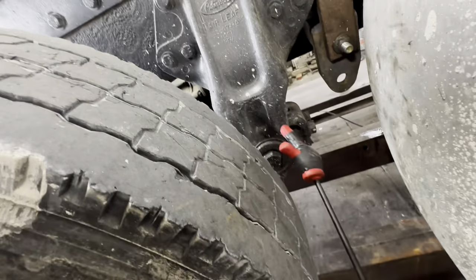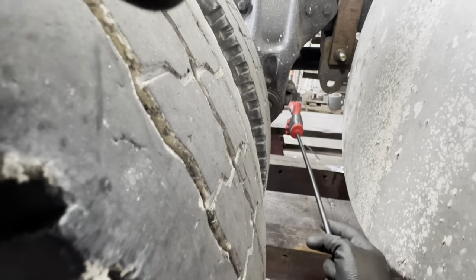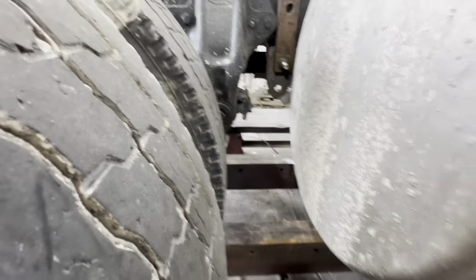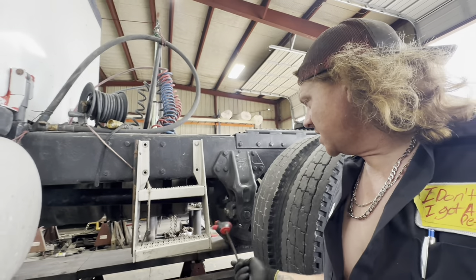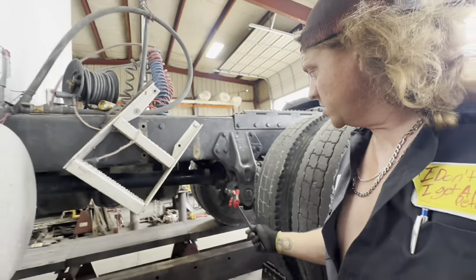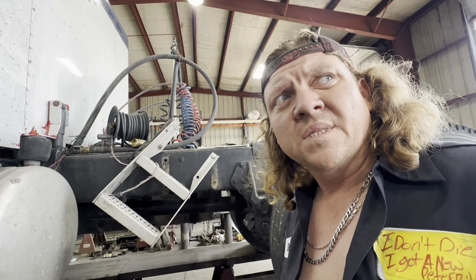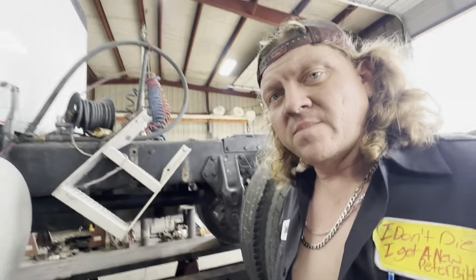This side has been changed — there are some washers in there. I'm glad I came over and looked. This side looks like it's been taken out before. What we're going to do is skip that side because the tank is in the way and there's not a lot of room. So I'm going to go back to the other side because it's easier. I've already got the step loose, so we're going to take these bolts out, loosen that, and add about an eighth inch — maybe a little bit more, like three-sixteenths. Tighten it back up and check it again.